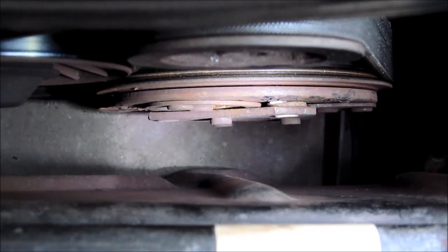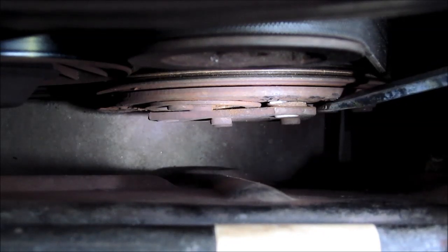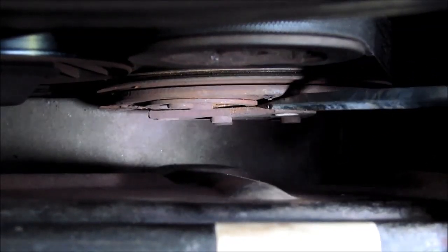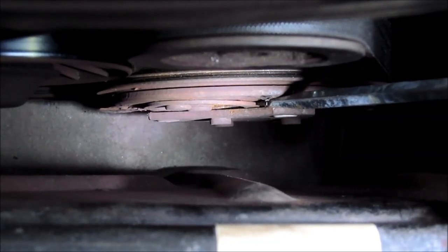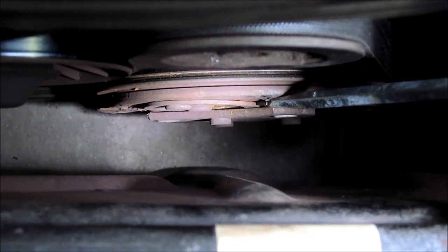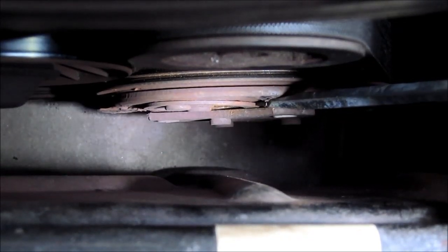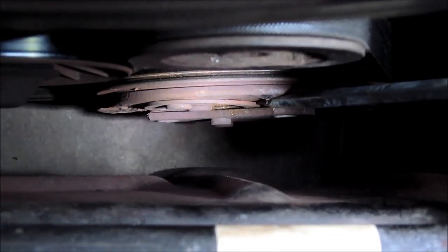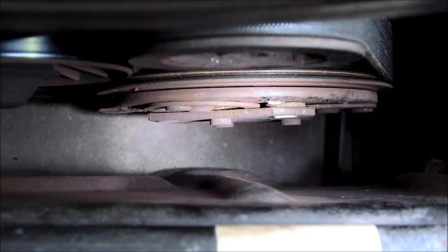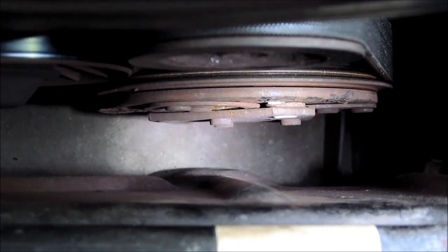So we're going to use some combination of little plastic shims to get in there. It's kind of tricky, but it is possible to wedge the plate further — it's got this little spring-loaded spider thing that sort of gives it some spring tension. You can stretch the springs a bit more and force it closer, so that is what we're going to do by putting little plastic pieces in the right location. That should revive the compressor enough for another summer of use.